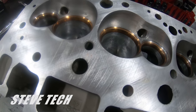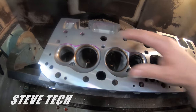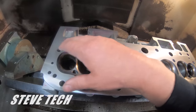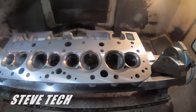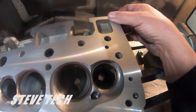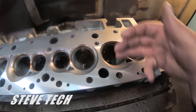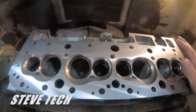We want a perfectly clean, perfectly flat surface. The other head from this package is already in the machine — we've already resurfaced it. What we noticed as we resurfaced it is it was high on the outside and actually low on the inside where all the bolts are, where all the clamping force is. I ended up taking seven thousandths off this head just to make everything perfectly flat. You can see this is an extremely nice, uniform surface finish right through the valve seat area — it doesn't drag or make an uneven-looking finish.